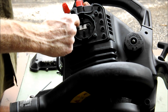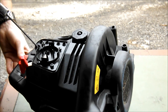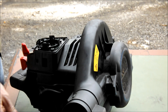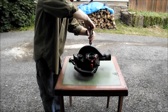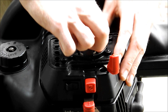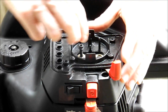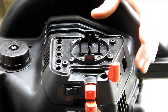These are your two carburetor mounting bolts. These also mount this part of the cover. The next step is to remove these two bolts. Carefully remove the carburetor mounting bolts. Make sure you keep any spacers, any washers, anything like that — keep very good track of everything. We'll put everything back exactly the way it came out.